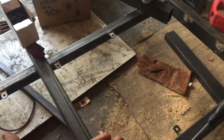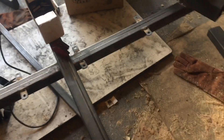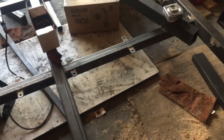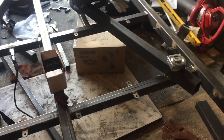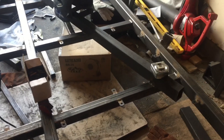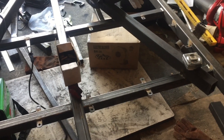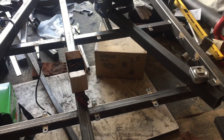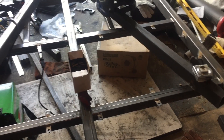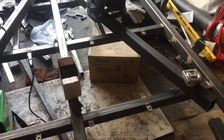My plan is to put a piece of quarter-inch plywood down from the other side, then fit one-inch insulation inside between the rails, then a single layer of three-quarter-inch plywood on top as the actual camper floor. Depending on the support spacing I might get away with half-inch plywood. This approach should save me at least an inch to an inch and a half of height compared to sandwiching, while still getting good insulation in there.